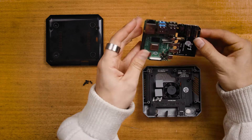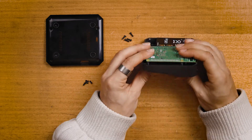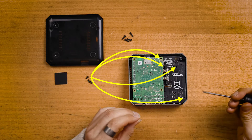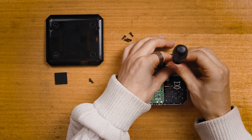When pressing the Raspberry Pi onto the case, make sure that the GPIO pins have lined up correctly. Now at this stage, make sure to use the smaller screws on these locations to hold the board to the top of the case.